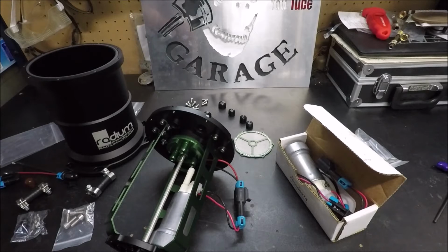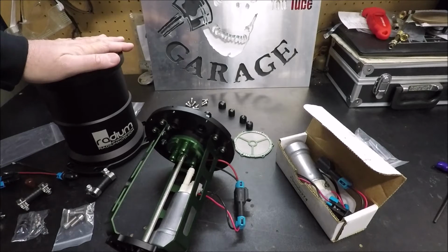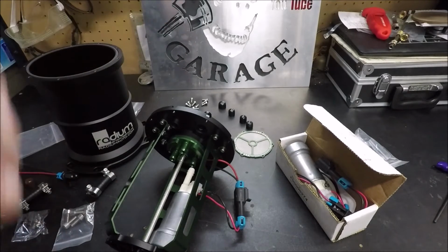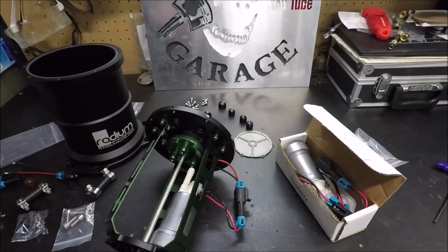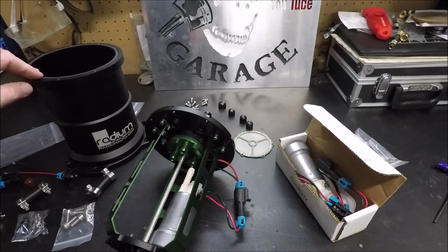But again, I should never have to upgrade this, guys. It doesn't matter if this car eventually makes it to, say, 1,500 horsepower or something like that. This surge tank is still going to keep up. Maybe not with... well, yeah, 3 450s running through dash 10 line might keep up with that. If not, we can throw 3 525 pumps in here. The point is, it doesn't really matter how far I want to take chaos theory. I should never have to upgrade the fuel system again after I do this, and that was kind of the point, guys, why I spent so much money.